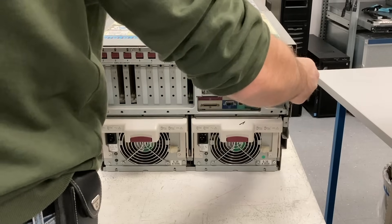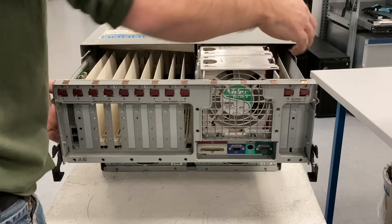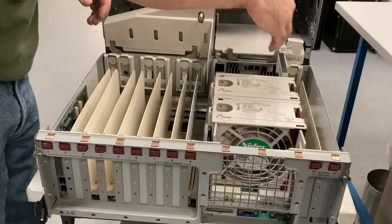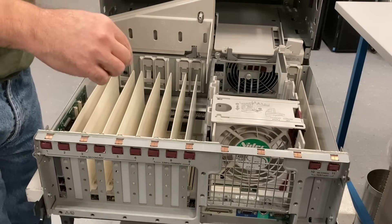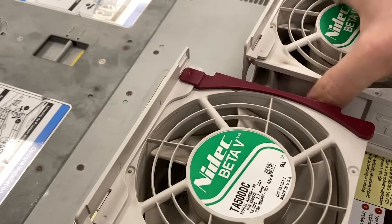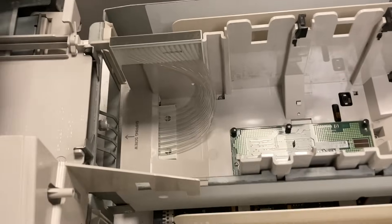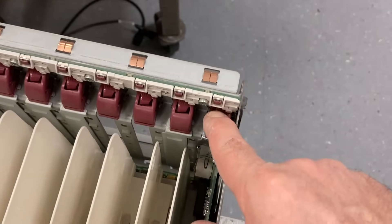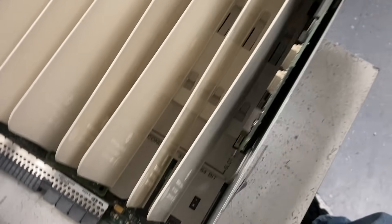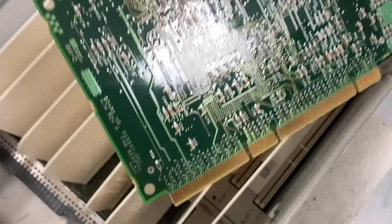There is also a drawer on the back side for all the I/O cards — therefore it is called the I/O drawer. You can also see the two fans, which are accessible when you remove or slide away the top cover — you don't have to remove the entire drawer for the fans. Compaq was pretty keen about their color scheme: they have this beige even for the propeller blades, very consistent. The insulators between the PCI slots prevent short circuits when you insert or remove cards, in case you accidentally touch a card next to one that's still powered.